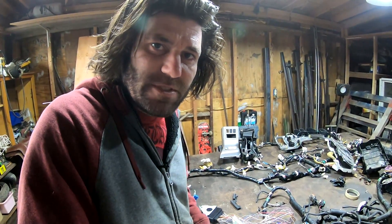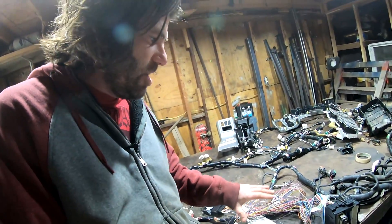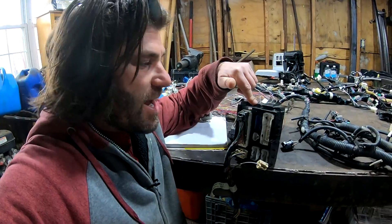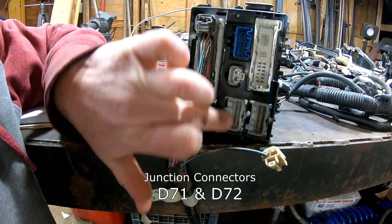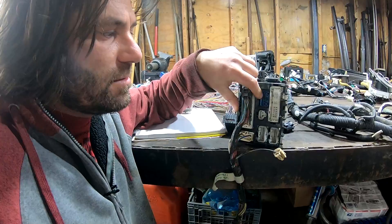I'm sure that's totally doable and that would be the way to go anyway - then you can flip it on when you're in two-wheel drive or four-high. Otherwise you're limited to four-low only. But in my opinion, you probably want to get rid of that rear end anyway because that locking rear is the less reliable rear end. The diagrams didn't really show me where all the plugs were that this thing runs through, so that's why I had to open all this up and figure it out for myself. Here's the junction box that came out of the Tundra that we're going to put in the Tacoma. These are just junction connectors, so there's no actual wires - just circuits being made in this plug.